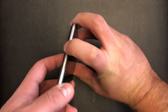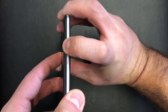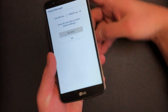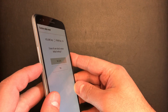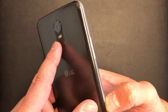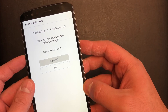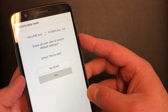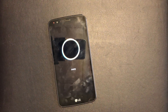Keep holding both — press and hold, the phone will turn on. Press again and keep holding. Now the recovery screen will come up. Use the volume down to scroll to 'Yes' and the power key to confirm. Now it's on the factory reset screen — scroll down again to 'Erase Everything' and press the power key to confirm.